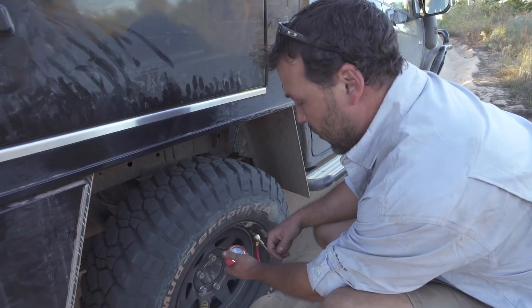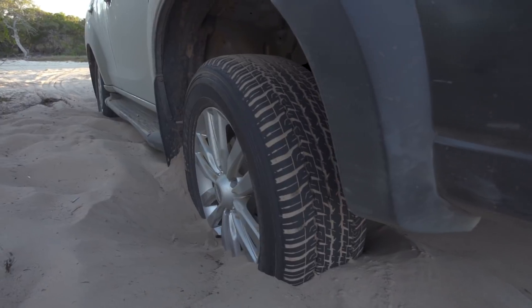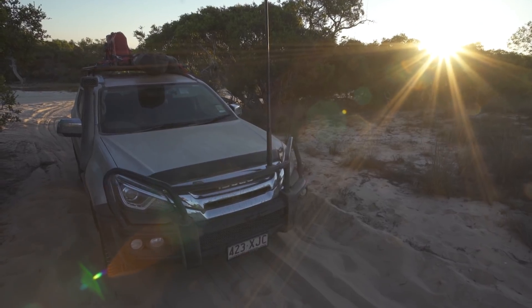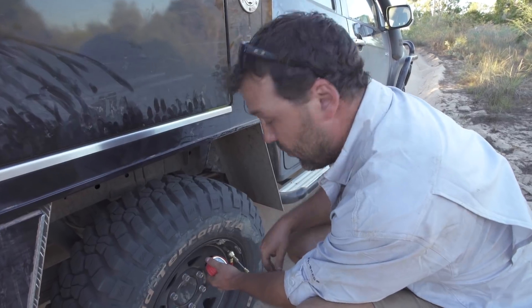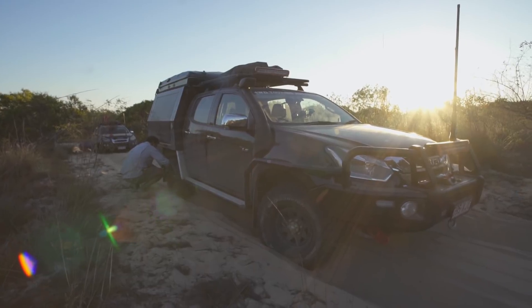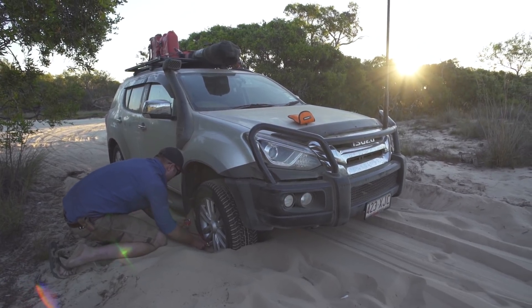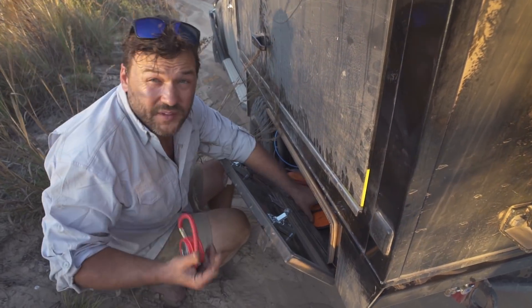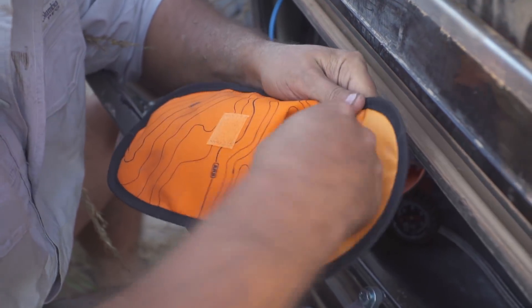The road to good fishing is often paved in soft sand. Here at Lorela we've been cruising around with a little bit lower than highway pressures for most of the tracks, which is fine, but out here at the beach things are a little bit different — a bit softer. So I'm going to let my pressures down a little bit as well. Lower tire pressures mean you're getting more flotation on the soft sand. Nine times out of ten that'll fix the problem — just let air out of your tires on anything soft and you'll get through no problem.